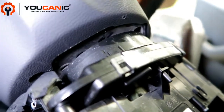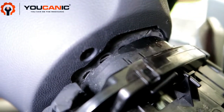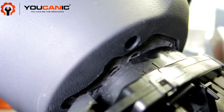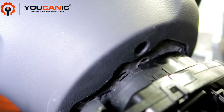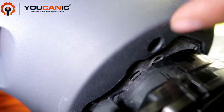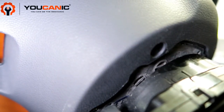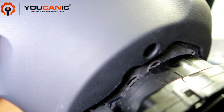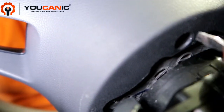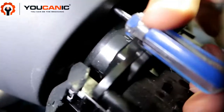But in this model there's no gap for you to insert the screwdriver. What you do have is this little hole in here — it's actually an indent and it doesn't look like a hole that goes through — but what you will use is a screwdriver to punch through that hole. So you'll take your screwdriver and just punch through that hole. Now once you do have the screwdriver in there, you'll want to push it towards the center of the airbag.